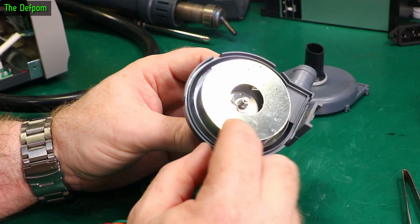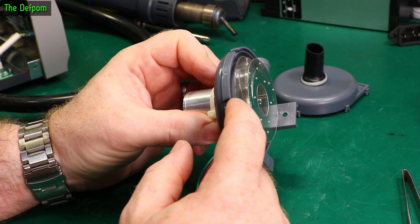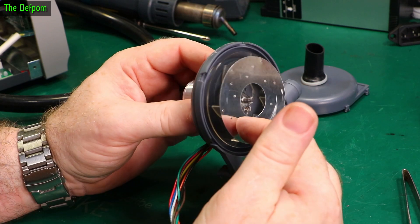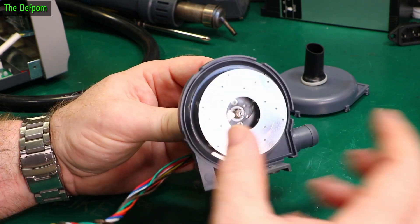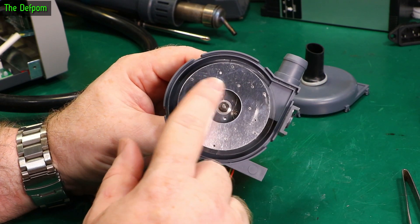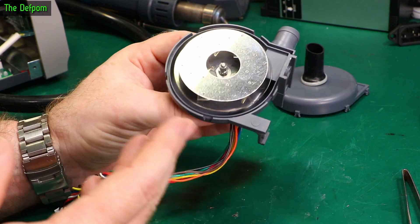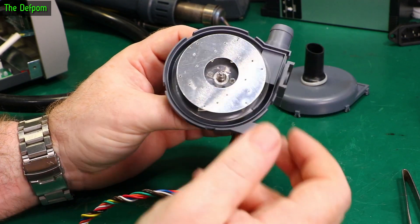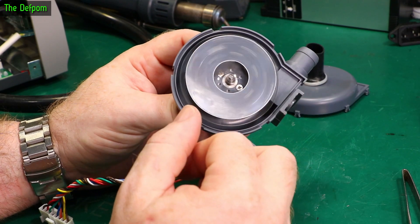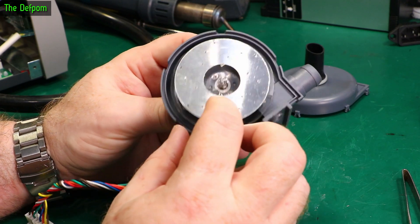It's interesting the way it's got this aluminium plate on one side. I suppose it's for ease of manufacture. So they've got a probably polycarbonate - might even be polystyrene actually. So obviously you have heat stakes thing out the top - little posts - and they put the aluminium over the top and then heat stake them, just squash them flat with the heater, which then traps the aluminium on. It's a cheap way of manufacturing it, but it's quite clever, instead of having all these little fingers which have to go inside or having two pieces of plastic stuck together. It's not bad, but it's cracked, so that's going to be problematic - especially as it's pressed onto a motor shaft.